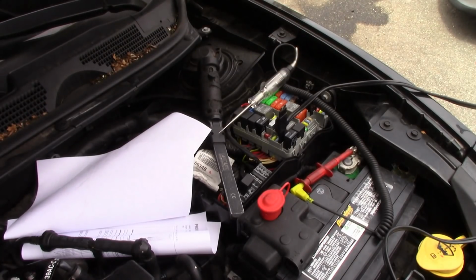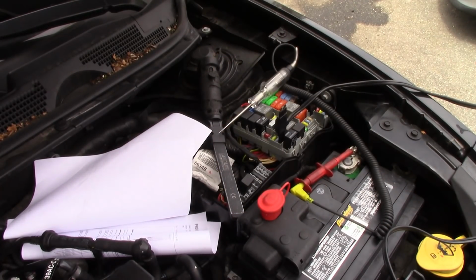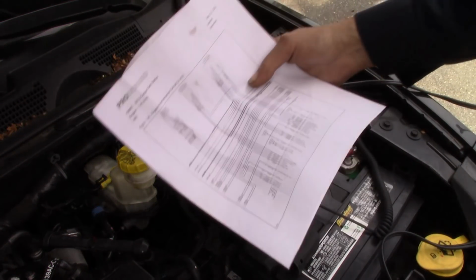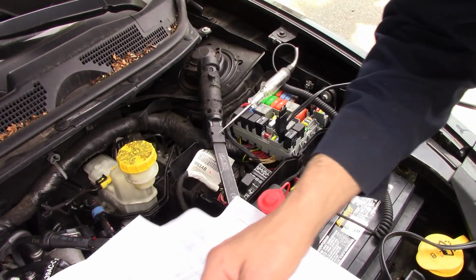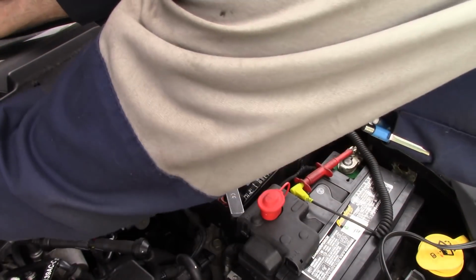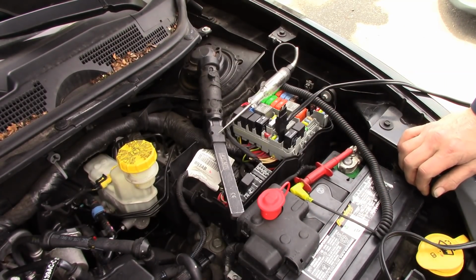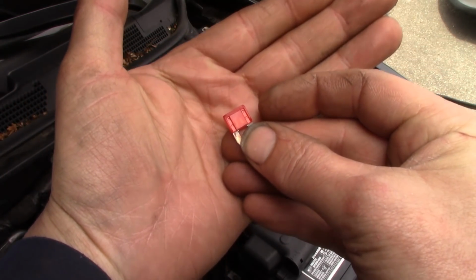All right, guys. So as we all know, when you have a blown fuse like this, you obviously have something, as I said before, shorted to ground, okay? There's definitely a short. The key with this stuff is to try to get to the root cause as quickly as possible, like always, right? So what I did was I allowed this thing to cool off a few minutes, and I came back to it and I started going around to harnesses and wiggling things, and sure enough, the new fuse also popped, if you can see that.